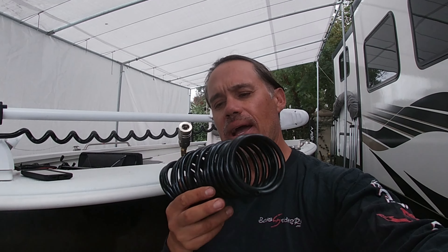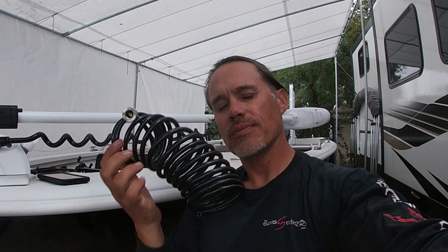So what I like to do: I grab some air compressor coil. I just bought this for like eight bucks, and that way you can cut it up. Having that memory built into the coil lets you wrap your transducer cable into it and gives it that memory spring so it'll spring back and forth. We're going to mount it right above the actual trolling motor foot base, so when you deploy your trolling motor, it'll spring out and then pull back in as you bring it back up.